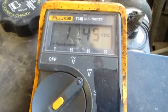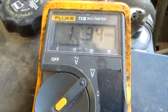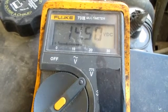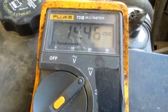The battery is probably good. Now I'm going to start the engine. When I start the engine — boom — there you go: 10.34 volts. That drop was caused by the starter turning the engine over.